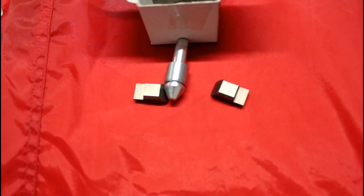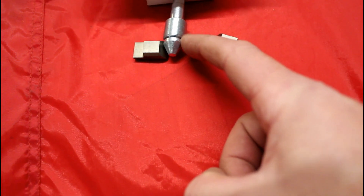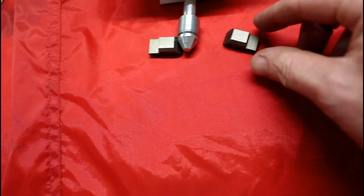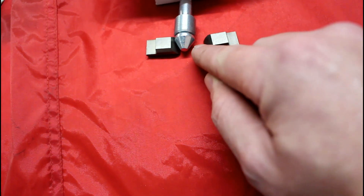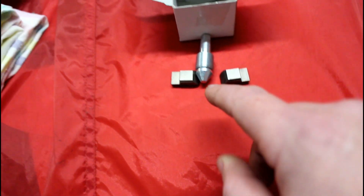In that little square box I've got one opened on the bonnet — it's the brake adjusters at the back. One point to note is that on the genuine ones the threaded section is a lot further up, whereas on the aftermarket ones it comes further down and the actual wedge adjusters can interfere with the threaded section. Also the angle of the aftermarket adjusters isn't quite right and you can have issues with it wearing funny. So I made sure I got the proper genuine ones from Mini Spares.